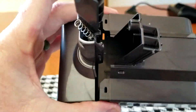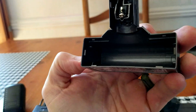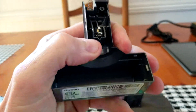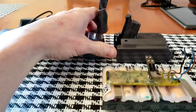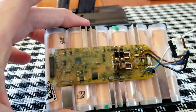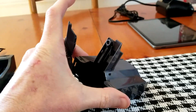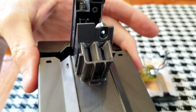There's a Torx screw right over here and then there's a little bit of prying because there's some prongs there, on the sides as well. You will pull that apart. Of course you will have to rip off the charge port connections here — the black and white wires — and we have the little management system and the charging prongs that go up into the unit to connect to your motor.